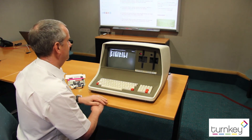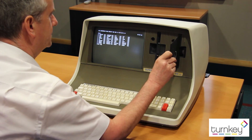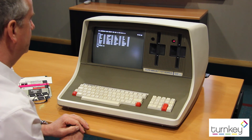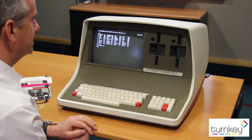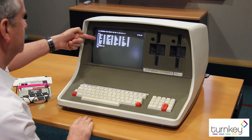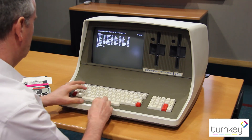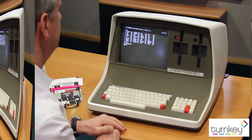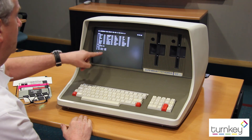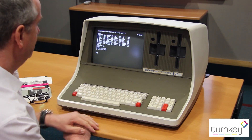DIR lists the contents of the drive. Directory of drive B. We have a machine that's booted. The contents of this disk just looks like it's the operating system itself — nothing exciting in the way of applications on here. The STAT command lets me see what space we've got left on each of the drives: 164K left on the A drive and about 320K left on the B drive.